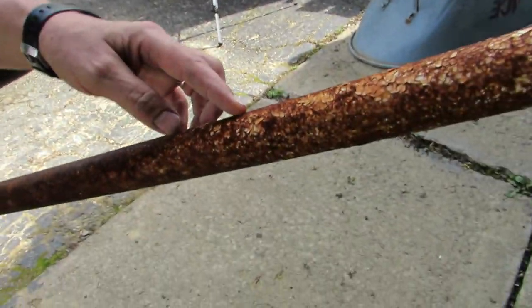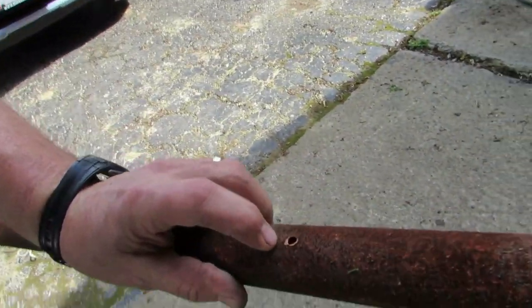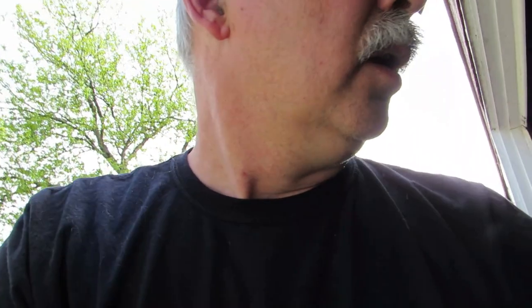It's galvanized steel, but you can see — I can pull this thing out and you're ready to see it. Sitting on my four-wheeler now. You can see how badly this rusted up. It's been painted, but it rusted through the paint. There's actually some holes in it and I'm going to try to fill those up too — maybe get my welder out here and weld those pinholes up. Water and moisture getting inside made it rust even worse inside, which is probably why it seized up so bad. I'm going to clean this all off, wire wheel it, sand it down, put some paint on it.